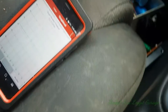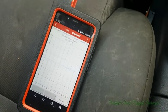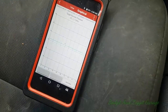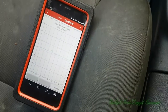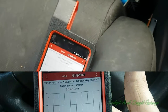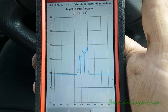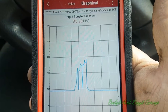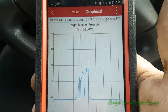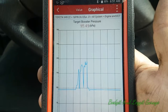It's going to be quite difficult to film this and drive. I'm just going to basically go first, second and third gear and we are going to see what we boost at. First gear is not really going to count but second gear will. Unfortunately I did try and film it as I was driving but I just couldn't do it. That's first, second and third gear and you can see we just reached just under 200 kPa — that was my foot kind of flat to the floor in third gear.